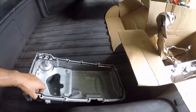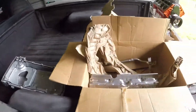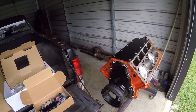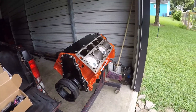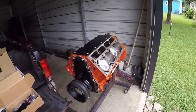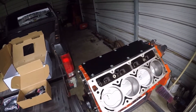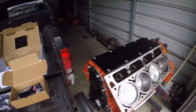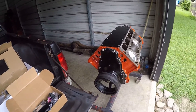That's not a bad price — $245 for all that. The next thing I'm going to do is put the oil pan on it, get the lifters down in it. I've got the lifters over there too, I just haven't stuck them down in the motor yet. I'm going to do the lifters next, put the oil pan on it, and then I may do the heads next.